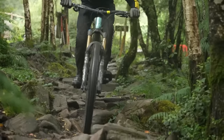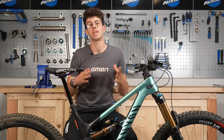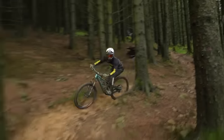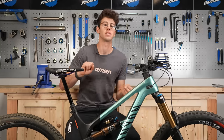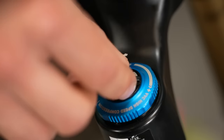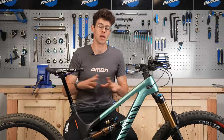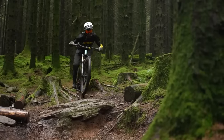Just getting your head around that has helped me a lot for setting suspension up correctly. What I've found is that riding fast flowing bike park tracks means I actually need to adjust my low speed compression, because I'm experiencing more g-forces and harder braking into berms. Adding a click or two of low speed compression — more damping, slowing the compression down — stops me diving and gives a more supportive ride. If I have separate adjustability on my shock I'll do that too, but definitely on the forks.